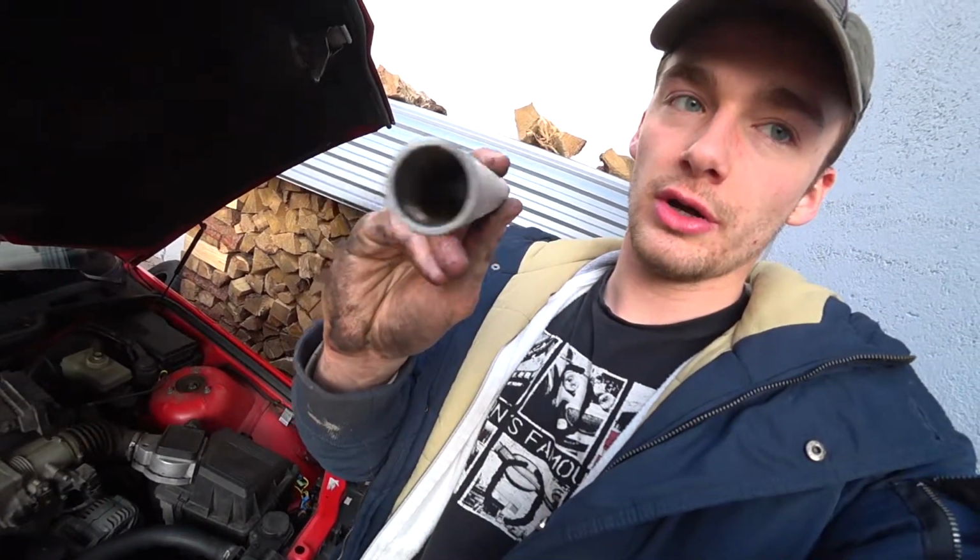The socket turned out to be a real pain in the ass since it didn't have something to go on a wrench. That was really hard, to get the plugs out. And also to give them 25 newton meters, that's actually impossible in the end, which is actually necessary in order to do it right.